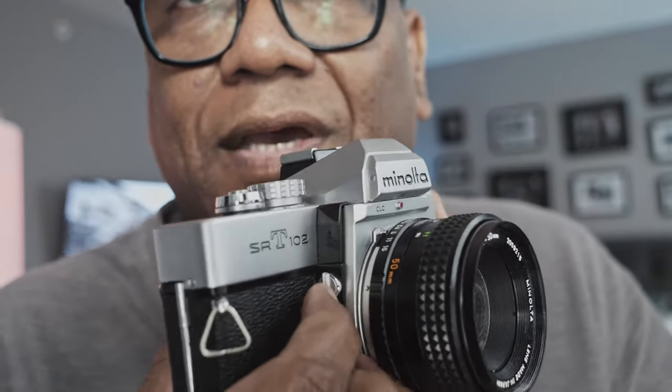I mentioned also earlier that it is a completely mechanical camera. And just a little tidbit here, a way to know that a camera is fully mechanical is by doing, all right, mechanical cameras use clockwork, like little gears to establish their time. The 1 second, 1/2 second, where cameras that use electronics for all their shutter speeds use quartz or some other type. It's still kind of like a watch assembly in there, but it just doesn't make any noise. Where these mechanical cameras, you'll always hear that.